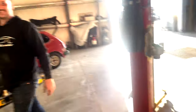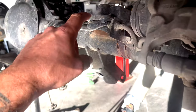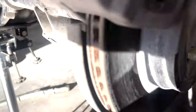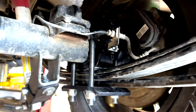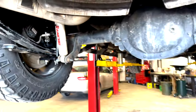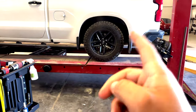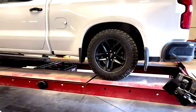Sean wrestled the leaf springs out and now they have to go back in. This is your drop — you get the automatic four inches from the diff plus the block. They offer a different shackle for a bit more drop, but we went with the basic setup. We've got the shock relocation, the flip kit — DJM — because you can adjust the pinion angle. The rear is done. Front is still at stock ride height; we haven't done the C-notch yet. We'll test fit a couple wheels to see if it needs to come down more — I don't think it's low enough.